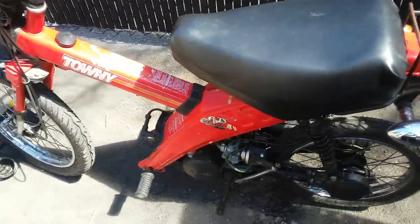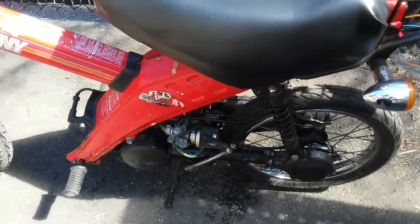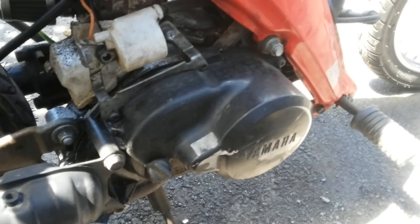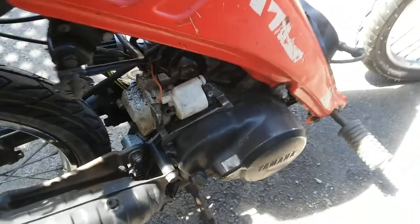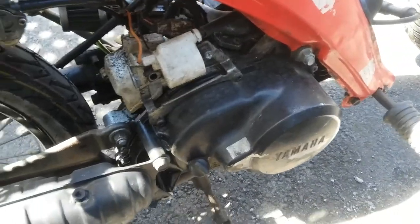Of course there was the engine rebuild and carburetor, plus a new exhaust gasket for the muffler, which is missing a tab but the other mounting points are fine. I also changed the transmission oil — unlike the Yamaha QT50 which takes 300 milliliters, this one takes 450 milliliters of oil.